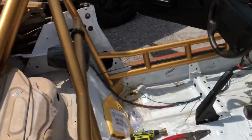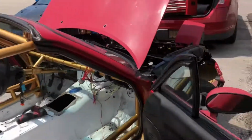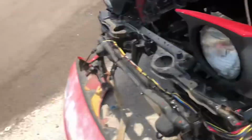I haven't messed with that. Mount the rear harness with harness tape. Everything in the front, again, I haven't harness taped everything. Everything is tested and ready to go. Radio works, running lights, high lows, turn signals, everything. So it's done. So right now, after I finish up the tidying up, then engine transmission go back in.